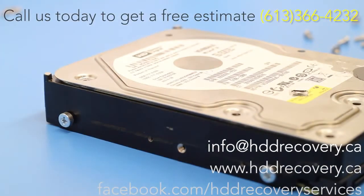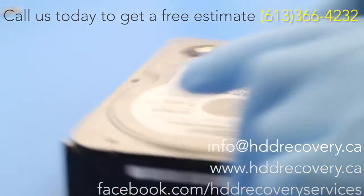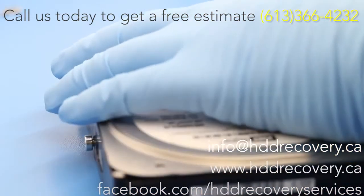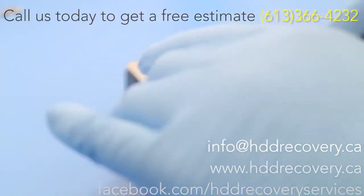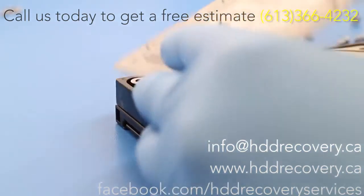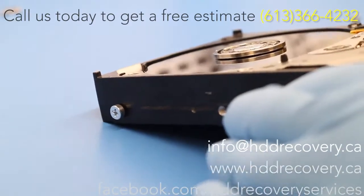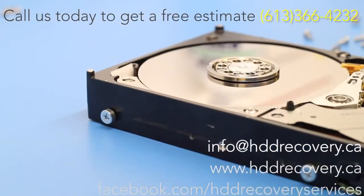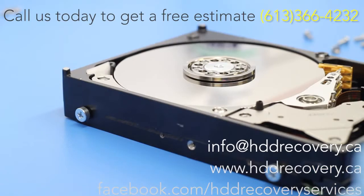Alright, so now we can remove the upper lid. You've got to be really careful around the edges, not to poke through the seal too much, because the platters are really close to the edge. And in our case, I don't see anything really abnormal. All heads seem to be in place, and they would be right there. None of them are missing from the armature, so it's a really good sign. So this drive is good to proceed with a head swap. We'll swap the parts out and power this drive on our equipment and see if we can get it running.